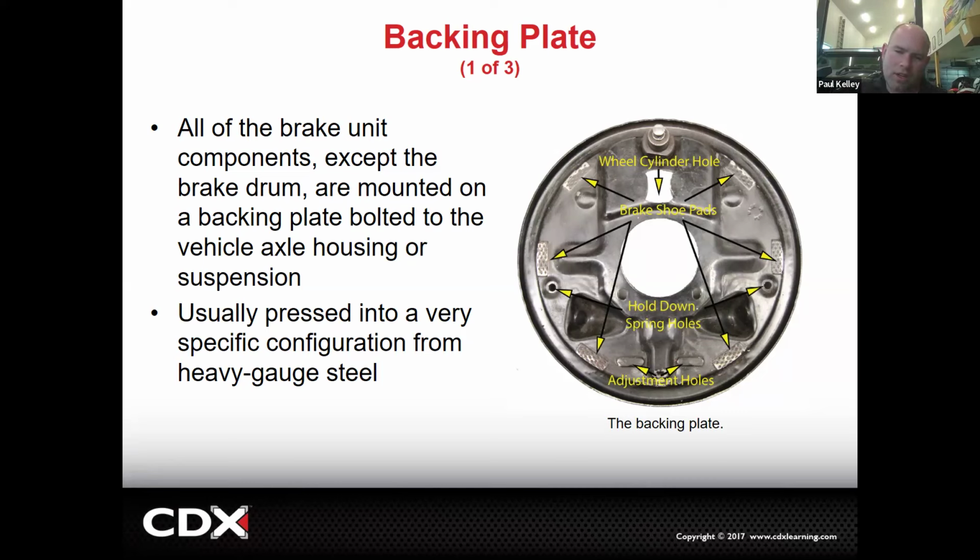Of course, you have to already have the drum off, otherwise that metal piece gets stuck and ruins the whole system. But once we knock those out, we're supposed to put a rubber plug back in there. That way we're keeping moisture out, and if we go through a puddle, it's going to reduce the amount of dirt and junk that gets in there.